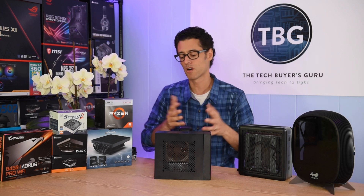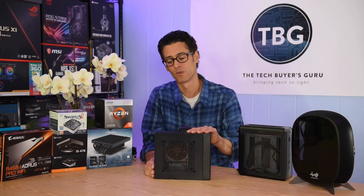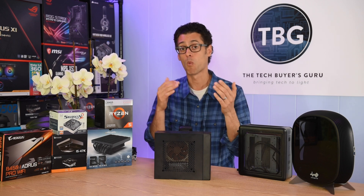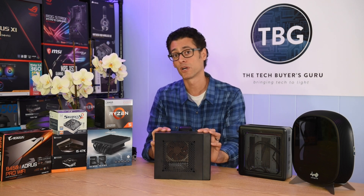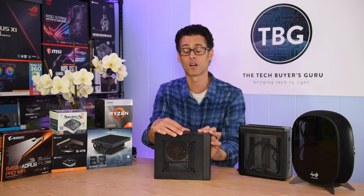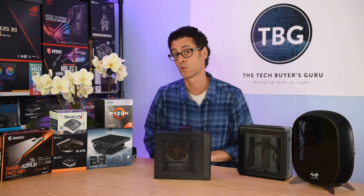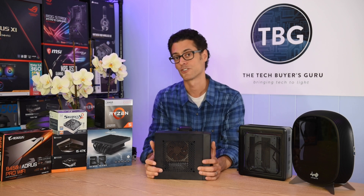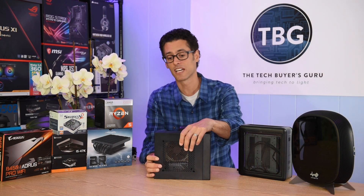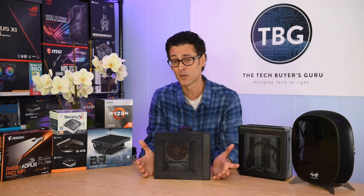You could go in here and use a Core i3-10100 or Pentium CPUs, but you could have done that with the Antec 10 years ago. I would love Silverstone to come up with a revision of this case — ideally two SKUs, one with a lower lid and one with a higher lid, both including power adapters, perhaps different wattage adapters more in line with what you might actually put in the system. If you want to use the higher lid, 120 watts just isn't going to cut it — unless they can get a 150-watt adapter that works, why bother? The other thing is I'd love them to update this mesh. This mesh is just not high quality enough. You have to get the airflow in, otherwise your system won't work — that's a pretty critical element of the design.